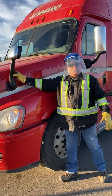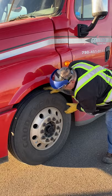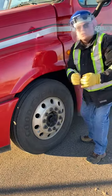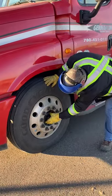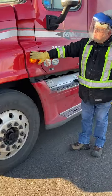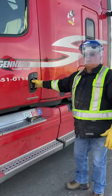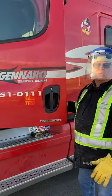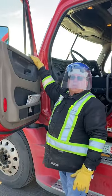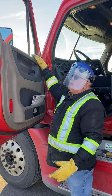My mirror is secure. Now checking the tread of my tire for even wear, outside for bulges and cracks, rim for cracks, lug nuts for securement and shiny spots — making sure you're touching each and every lug nut. Center hub for any oil leaks and fluid levels. Your valve stem is centered and capped. Signal light is working. My mirror is secure, my window appears to be good. Open your door a couple times making sure it closes properly. Test your windows up and down, stepping up on the step if you need to so you don't lock yourself out of your truck.